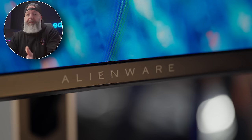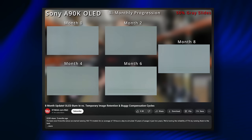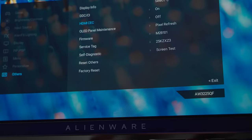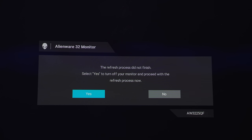Burn-in and image retention remain a major concern for people cautious about OLED. The short answer is we still don't really know, but manufacturers seem very confident going all-in on OLED this year. Rtings.com has done burn-in tests on the TV side suggesting QD-OLED burns in faster than W-OLED, but results vary quite a bit depending on how each manufacturer implemented anti-burn-in features. These monitors have solid anti-burn-in features, though I'm not seeing specific modes for logo or taskbar detection. Importantly, unlike other manufacturers, Dell offers three-year warranties on their displays — and that includes OLED burn-in.